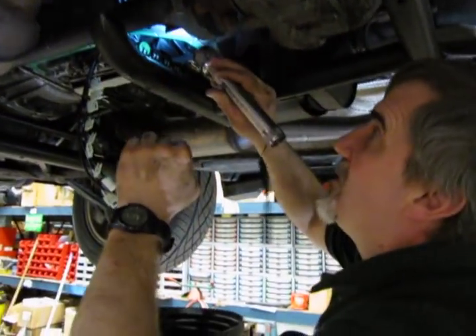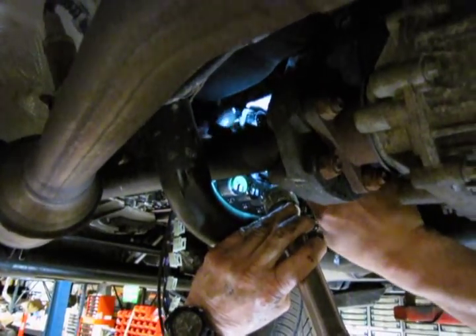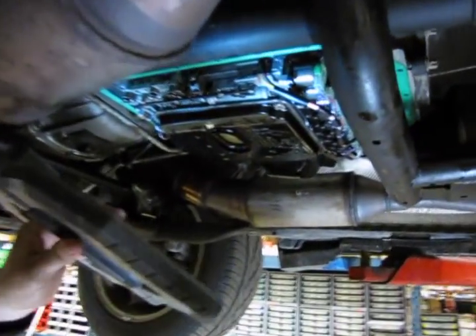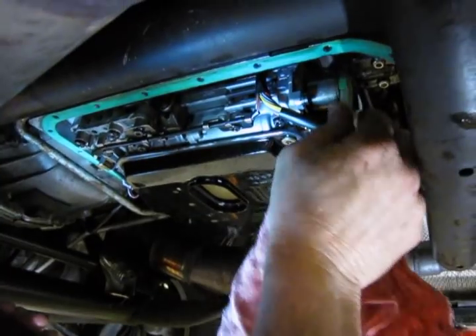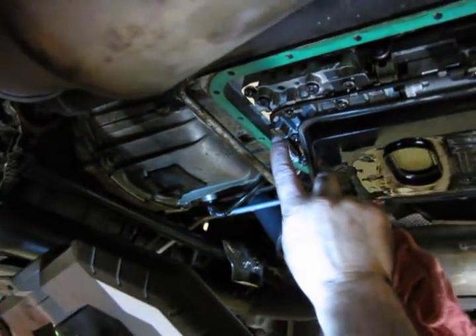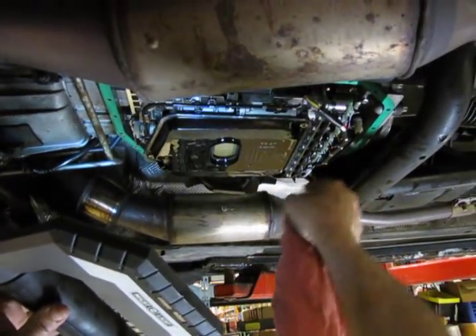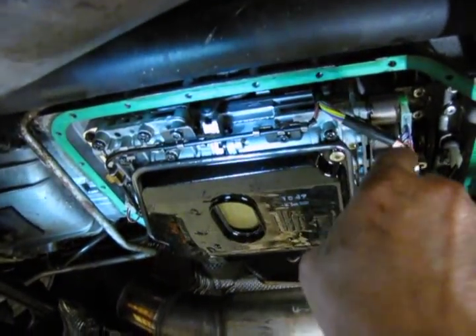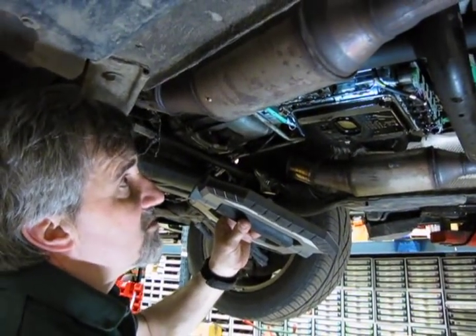Once you get it started, we'll get a pry tool or a small hammer in there and just tap that in place. So now we have everything in place. We're just going to show you the routing where you have your output speed sensor and all your solenoids plugged in — make sure everything is in and secure. Here's your routing for your front input shaft speed sensor — make sure that's all up in place and secure. Your two retainer bolts for the front and single rear speed sensors — make sure everything is exactly where it's supposed to be. We've got the connector up in place, we have the retainer tab on, everything is in and secure, and we're ready to put the pan back on and refill the transmission.